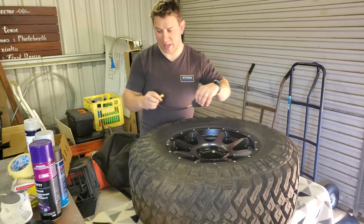I'm just going to do a light coat of spray putty over the whole thing first. Sometimes with sandpaper you get fine lines that show up in the paint, so a light coat over the top helps with that. Once we've done that full coat, we'll focus on the damaged areas — they're quite obvious now that I've scratched them up with sandpaper. Then it's layer of spray putty, sand, repeat, until we get a nice smooth finish.